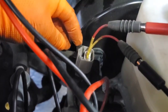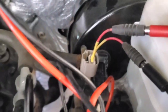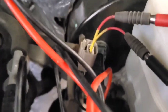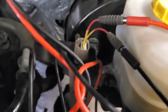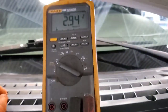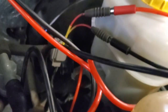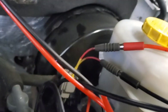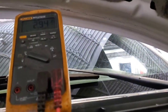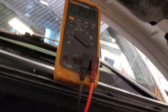If it was in spec, I would do a resistance check between the sensor wire and the module, and if that's good, then we'd have a bad sensor. But with this reading, we can tell we have a bad ground or a 5 volt reference circuit. The next step is to wiggle the harness to see if we get fluctuations on our meter — that way we can tell if it's an intermittent wiring problem or a bad ABS ECU if there are no fluctuations.